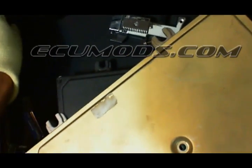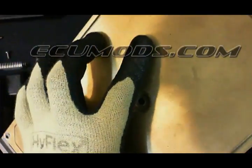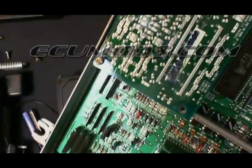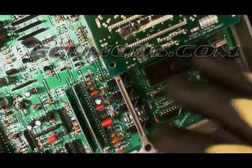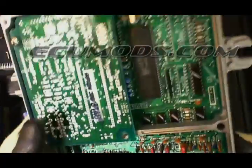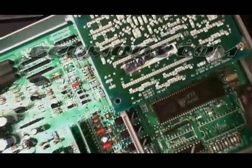We removed the screws. The screws that go on the ECU — you'll find five of them along the top, and they look something like this. Upon removing the lid, it's important to remember a couple of things. First off, this is an electronic system, so it is static sensitive. When you start touching the surfaces, be careful. Make sure you're wearing ESD gloves — not rubber ones, not plastic ones. Make sure you're not on carpet; concrete is preferred. Handle it with care.